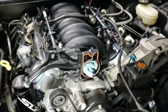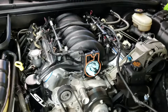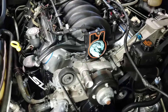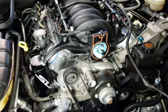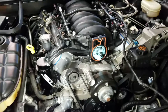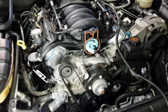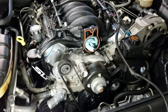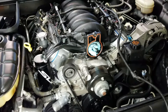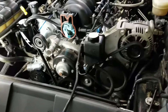This was a perimeter bolt to center bolt valve cover conversion. Anytime you're going from the old 806 heads — which I think were perimeter bolts — to the 243 heads or 799 heads, or any of the newer heads, they're all center bolt. Much better design in my opinion. It's what I'm used to. You get a better head to come along with it, but I don't mind getting rid of the perimeter bolt stuff. All my perimeter bolt stuff will be for sale in the future. It turned out really good — happy with the conversion.